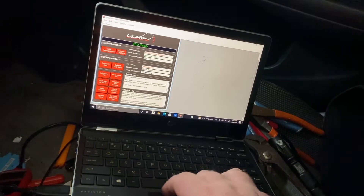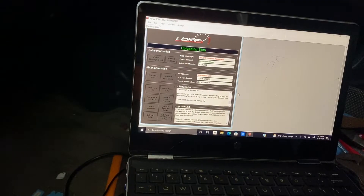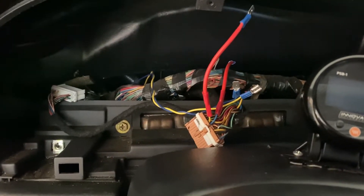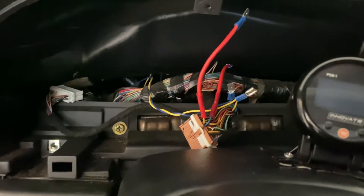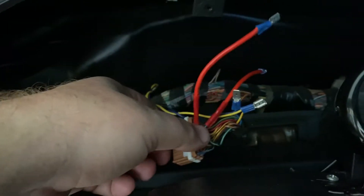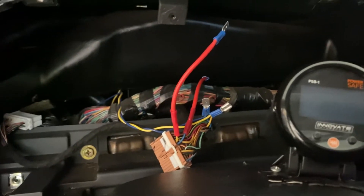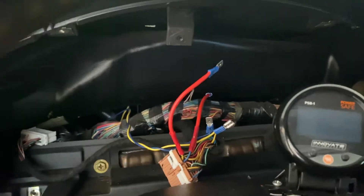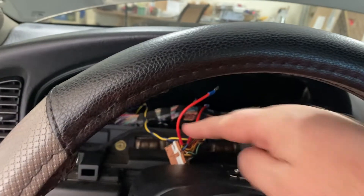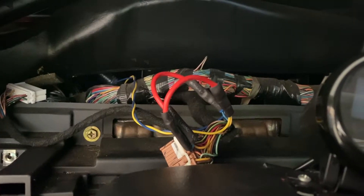ECU ready — it's flashing the tune file. About three minutes this time. Alright, I'm redoing the CAN wires in a bit of a janky way — I've got a butt connector there. I was just having trouble getting everything fitted nicely; if this harness wasn't in the car it would be a lot easier. Of course I'm not going to leave them exposed — I've got heat shrink wrap going over both the butt connectors and those connectors. Hopefully that'll work.